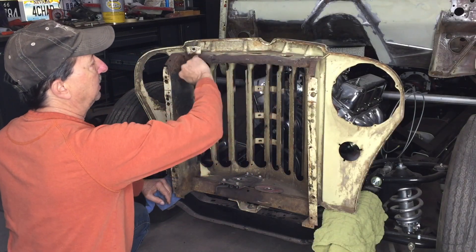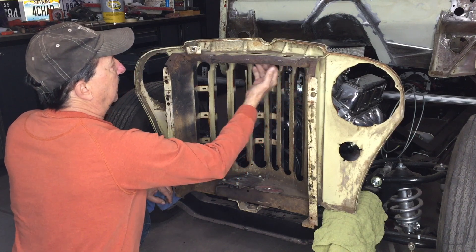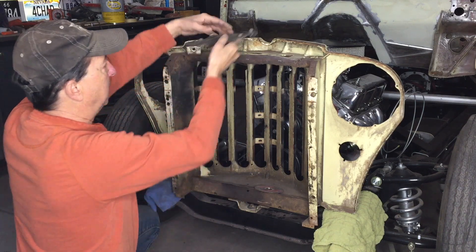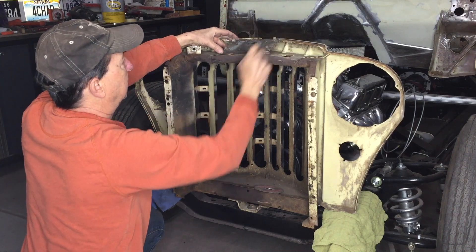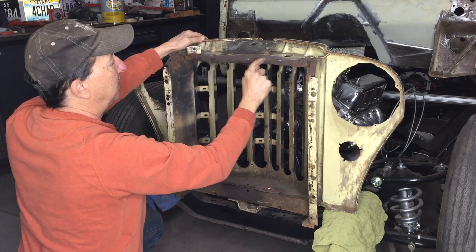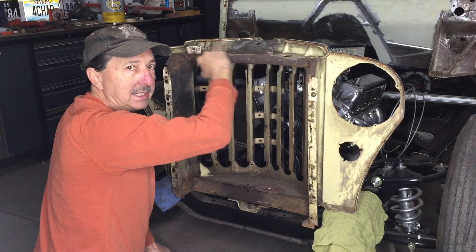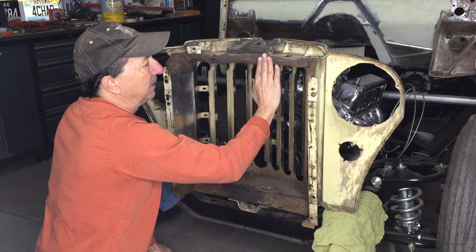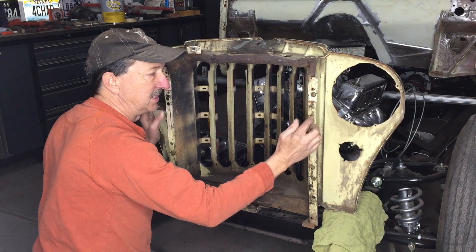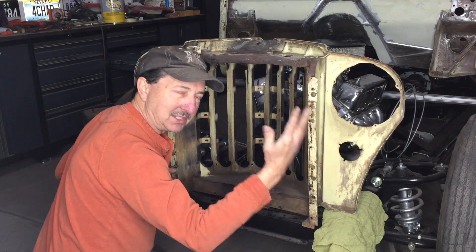This area is what's pushed up - it's got some stamping areas and I like these ribs. I'm thinking what's probably going to be best is I want to get the radiator as close to this bracket as possible. If I cut about half inch to three quarters of an inch away from that stamping, I'll be able to flatten this back out again to get a really nice clean professional finish on top. That gives me the distance I want for the radiator to set back in. Interestingly enough, this is the exact width of the radiator for the Mustang - I could literally just bolt it up to these flanges and it's ready to go.